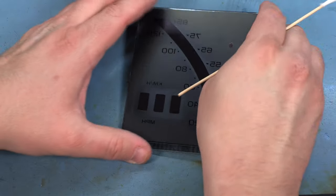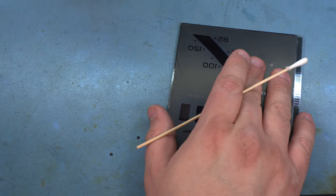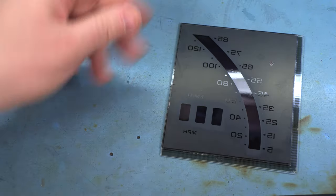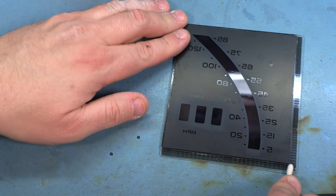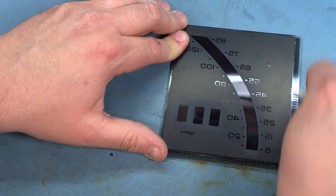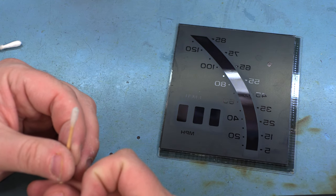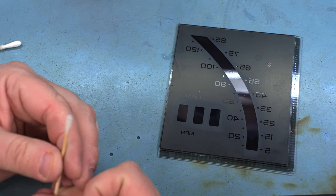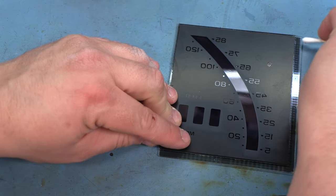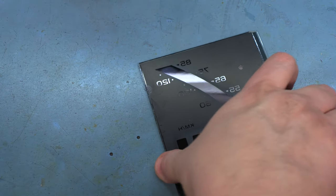Definitely when you're working with these panels, don't let them hit each other. Two panels sliding into each other just very slightly can cause both to crack. Replacement panels are available, but they're very expensive, so we don't want to do that. Again, we're going to use the alcohol Q-tip on the remaining panels — at the end of those three panels there was quite a bit of debris, they weren't clean. Now we'll use a dry Q-tip and set those aside to let them dry as well.